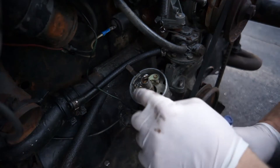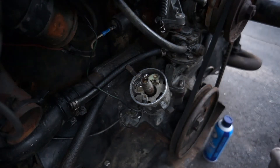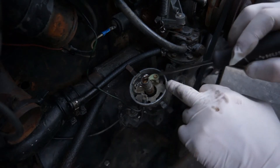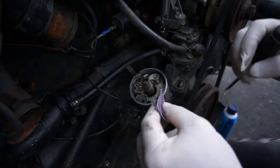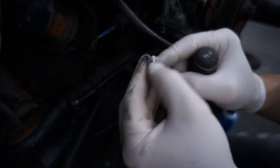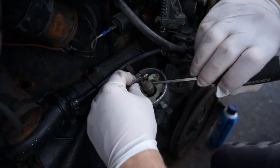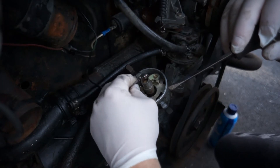I turned it over — I'm here by myself so I can't really see if there's spark there, but you can see where those two pads touch. That's the prime candidate: if we're not getting spark right there, this thing's never going to start. If the condenser doesn't work right, the coil doesn't work right. But it almost started so I know we've got spark. These points look pretty clean with that dust cap. I do see a little rust on the distributor shaft, so I'm going to fold this emery cloth so it's got grit on both sides and clean those points pads.